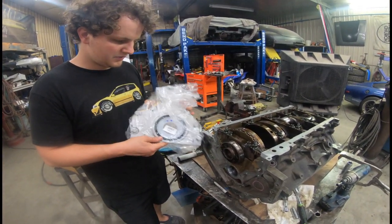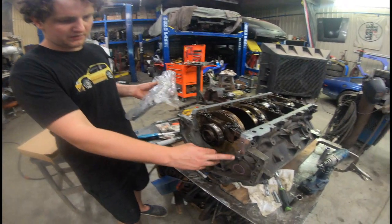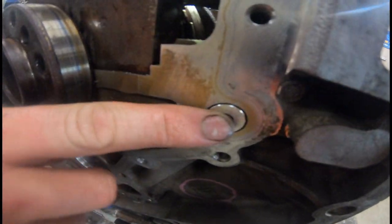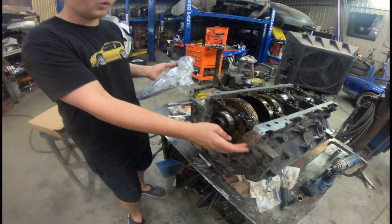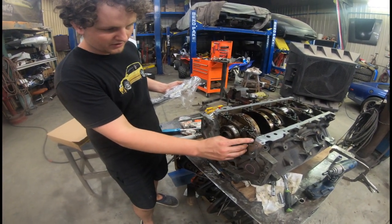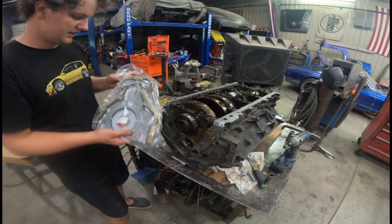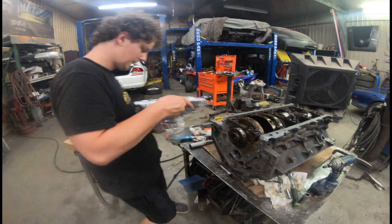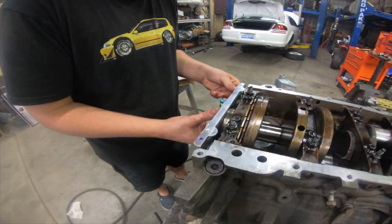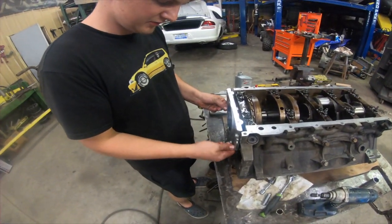This is a new cover — we might as well change it out since we got the motor out, and we had to take it off to install this billet dumbbell-shaped thing for the oil. So we're going to put this on. We put a little bit of RTV right where the oil pan meets and then put this on. It comes with three fitted gaskets, new seal, and all the bolts too.